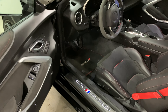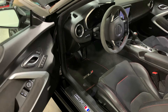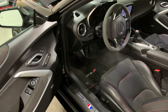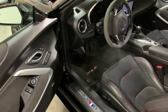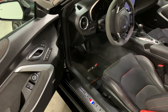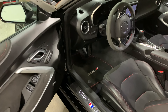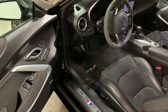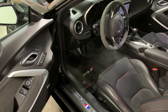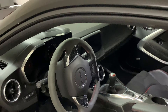Chevy does it a little different than what most manufacturers do. Most manufacturers you can just push the button and it goes to that memory setting. With Chevrolet you have to hold the button. Setting it is actually fairly easy, but what people mess up is after they get it set they don't hold the button — they think it's broken, stop using it, and the settings get all messed up. Also the easy exit feature you kind of have to go into the dash and turn that on.